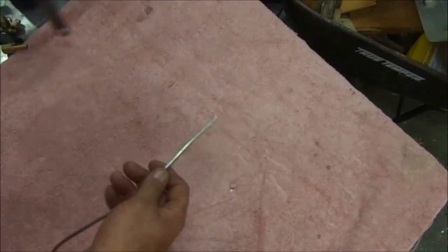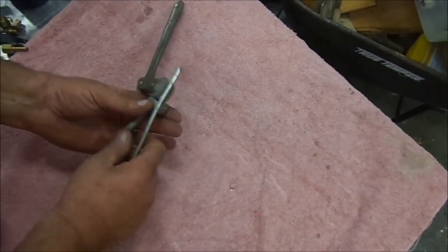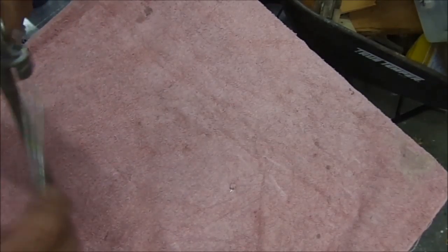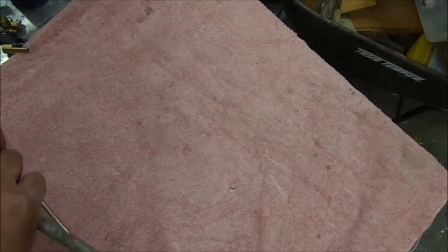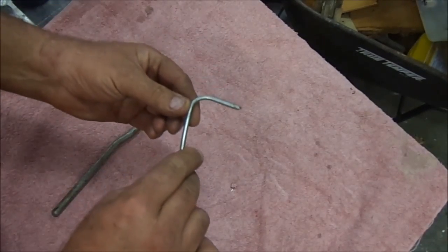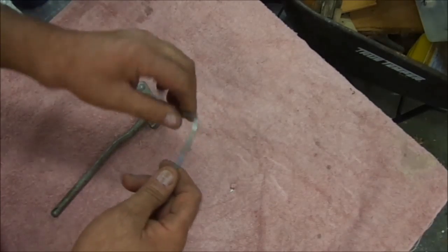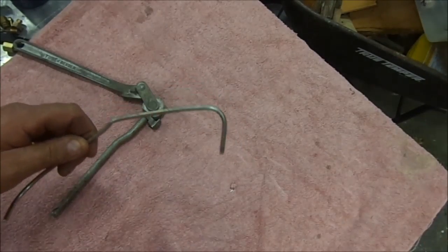I'm in a hurry, so I apologize for the quality — I actually hadn't planned on recording this. But the brake line has got some really sharp curves to make, and I want to show you this old tubing bender. You can use a spring, but I've got some pretty tight curves to make. Look at that — I'll be able to bend it without crimping it or losing any of the flow.